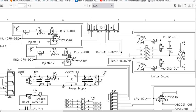So as you can imagine, these things are just flashing right now, really slow. I'll look over here and tell you they're going blink, blink, blink, blink, blink, so that you can see them, okay? If the engine's running 1,000 RPMs, these are going to be lit solid. They're not of any use to you except to say, oh, this one's never lit. There must be a problem. That's why my engine just sounds like it's running on one cylinder. Okay, that's the only purpose for the LEDs once it's running. But when you're first setting it up, they could be extremely helpful in diagnosing, am I even close in what I'm saying in my settings of my engine for the crankshaft sensor? And some other things that I'll show you, maybe I'll show you in this video.